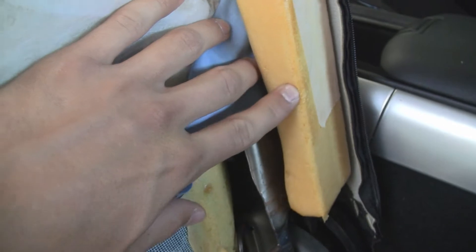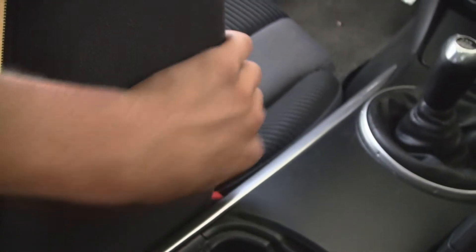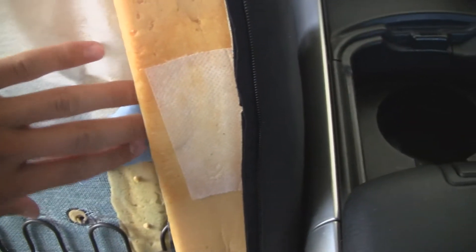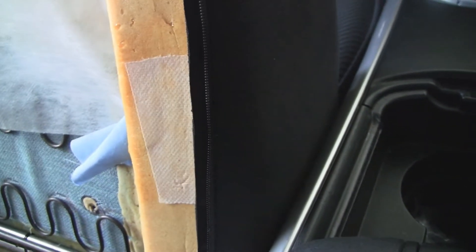What I had to do was stick a piece of cloth behind here — just behind this yellow one, but before this metal here. Because that frame wraps around and goes all the way up to the front, and it rubs against the padding there. That's where my squeak was being produced from. So by wrapping the cloth around, I had to get my hand all the way on the inside and place it around that metal, and then that made my squeak go away.